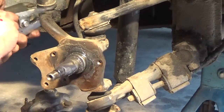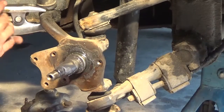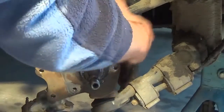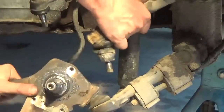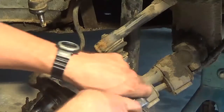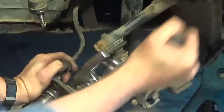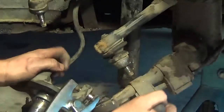The steering arm is held on by a little split pin as well. A ball joint separator was needed — they were pretty tight. You had to pop it off with that; you can't bang them off, you've got to use a proper tool unless you want to replace your ball joints all the time.